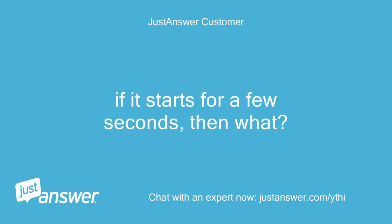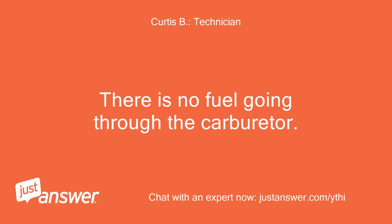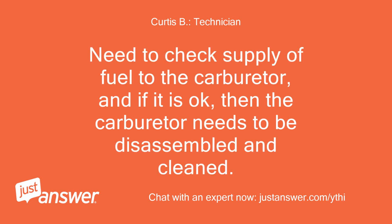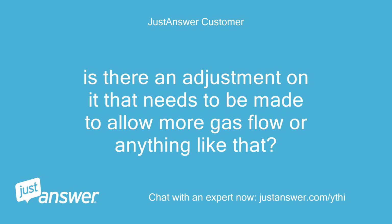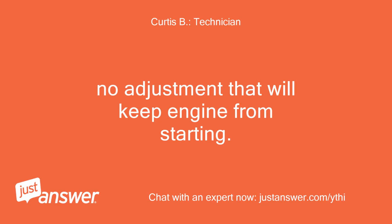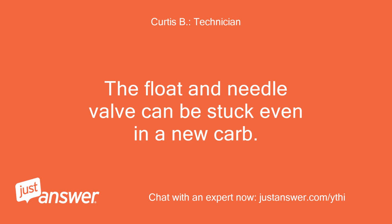If it starts for a few seconds, then what? There is no fuel going through the carburetor. Need to check supply of fuel to the carburetor, and if it is okay, then the carburetor needs to be disassembled and cleaned. Carb is brand new. Is there an adjustment on it that needs to be made to allow more gas flow or anything like that? No adjustment that will keep the engine from starting. The float and needle valve can be stuck even in a new carb.